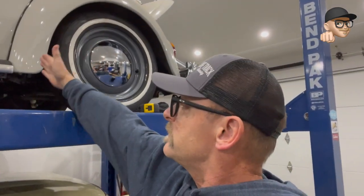The fuel tank went in today. I've got a fuel filter that's going in line between the engine — there's a space right in front of the transmission where I'm going to put it. It's serviceable and out of the heat. These cars have a really bad habit of getting very hot and the fuel filters can catch fire, which we don't want. It's downstream of the fuel pump but before the carburetors, which is what you want when you're running carburetors — they're very finicky with dirty fuel.